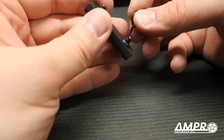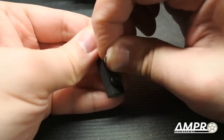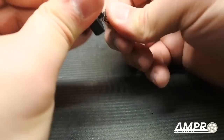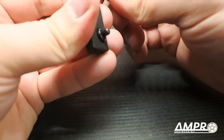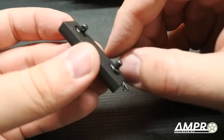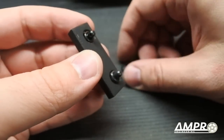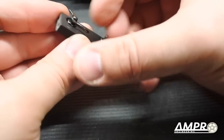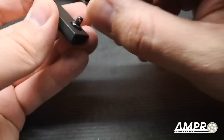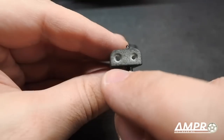To tighten these up further I have another method — I'm going to take a body pin, install it like so, and simply rotate it. My recommendation is that you stop rotating the body pin when the hole is along the axis of the vehicle, since this way it'll allow you to push these on very easily from the front or rear.